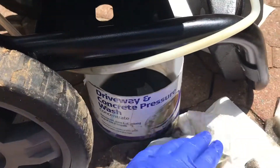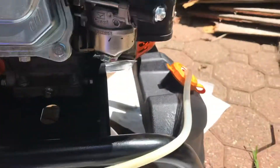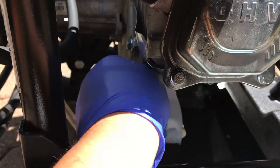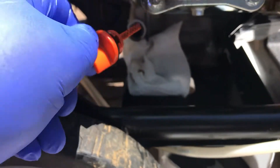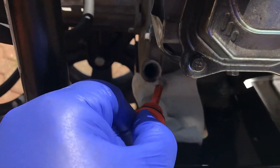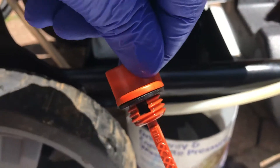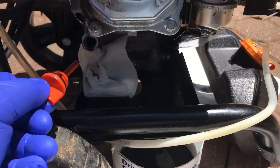Now how we fill this — we'll get rid of the spilled oil, grab a towel. Open up this orange cap here — get another towel under there just in case. This is your dipstick inside. Wipe it clean, put a funnel on there, pour some new oil in, and check the dipstick every once in a while to make sure you're at the fill mark. Once you're at the fill mark, you're done. Then put this back in and tighten it hand tight so it doesn't leak.